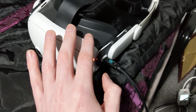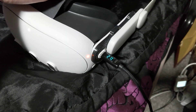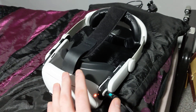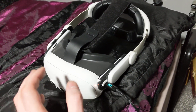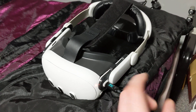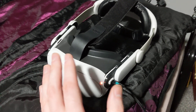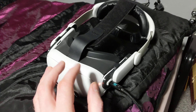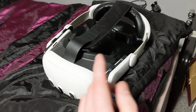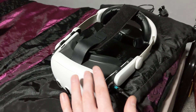The only thing you can do to get a bit more power draw — and this is obviously going to increase the draw — is that it sees it needs more amperage when you turn it on. Whether that actually equates to a faster charge or not, I don't know. I already tested a BoBo VR battery bank — that's a 5 volt 2.5 amp power bank off the Quest 2 BoBo headstrap. Just looking at the UI screen, no game playing, no downloading, half brightness, Bluetooth off — I left it about 20 minutes and it only went up 1% on the gauge. So that's not really going to be sufficient to charge this headset.